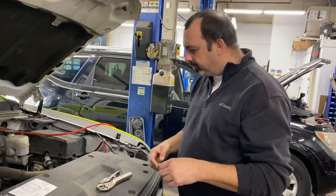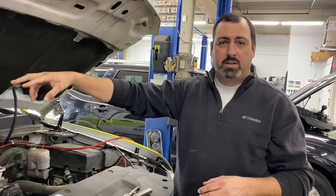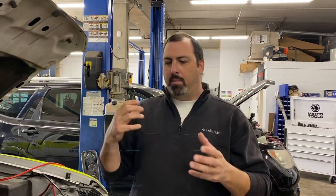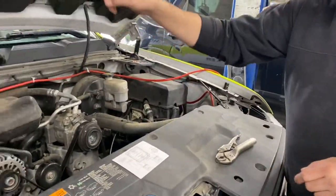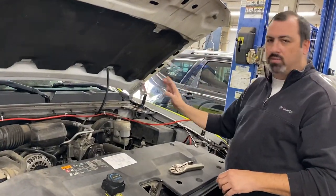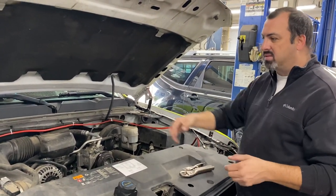The reason why we're doing that is because we've got to close the circuit. One of the things you may not know is that we're actually going to do what's called a parallel circuit. That means we've got a 12-volt battery to a 12-volt battery, and we want it to stay in a 12-volt system. To do that, we go positive to positive, negative to negative — hooking up the positive terminal to a positive terminal, a negative terminal to a negative terminal. Now, you may see power equipment that says 18 volts or 24 volts. That means the batteries have been put in series — positive goes to negative, then positive to negative, positive to negative — and each one of those ramps up voltage. So if I went positive to negative on this battery, and then positive to negative on that battery, that makes this a 24-volt system. We don't want a 24-volt system because it would overload — too much voltage, too much energy. So we want it to be a 12-volt system, so we're hooking it up in parallel.